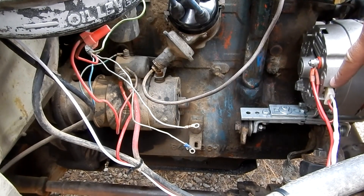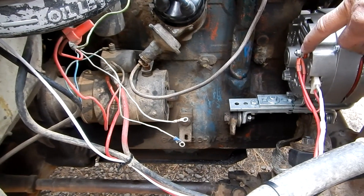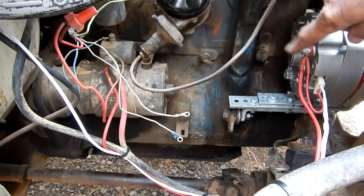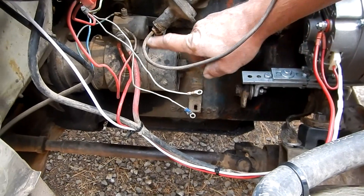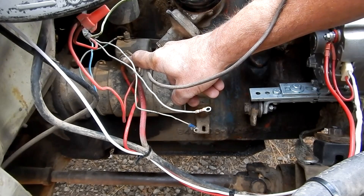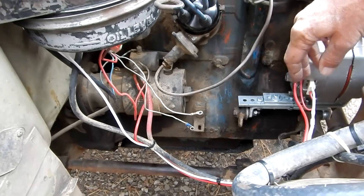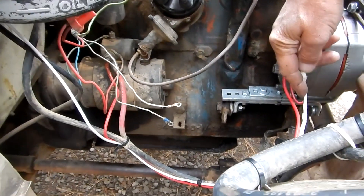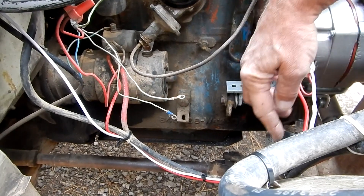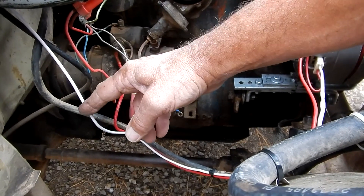The alternator is wired from the plug back to the battery post with the little wire that comes with your harness. There's a bigger wire that goes from the battery post down to where the end of your positive battery cable is, which is at the solenoid — that's going to charge your battery. The white wire, which has a resistor in it — don't lose that resistor — goes into the cab under the dash to the back of the ignition switch on the post marked IGN.